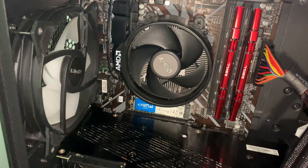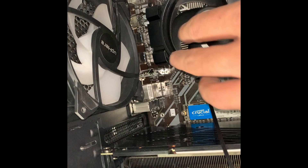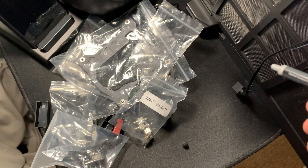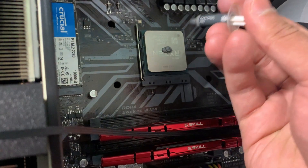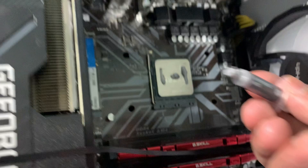What we're going to do is remove the CPU fan, pull out the CPU fan header, and set the old cooler aside. The next step is to grab one of the alcohol pads and give the CPU a nice rub down. Then grab the thermal compound from the Intel LGA bag, unscrew the black cap, and apply it. I usually just go for the middle drop method — put a drop right in the center and a couple more around it. That should be good enough.